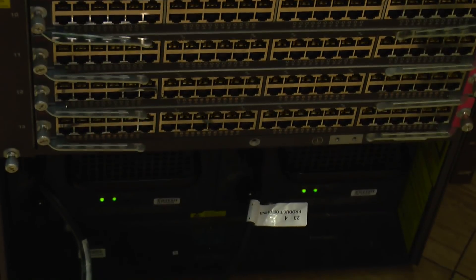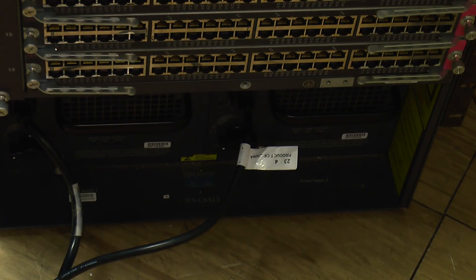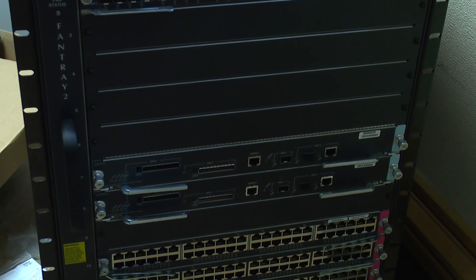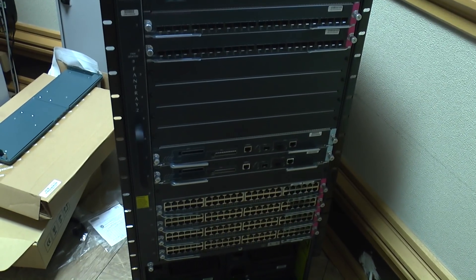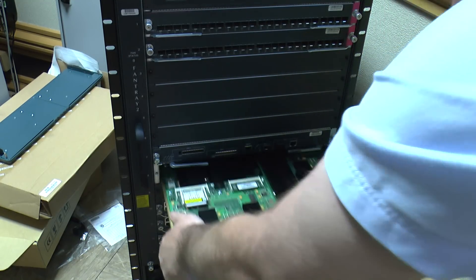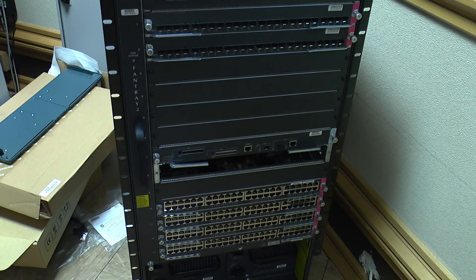Let's take a look inside. This is a modular chassis where the cards can be removed just by undoing the thumb turn screws on either side. You pull the levers and slide them out. This can even be done with the power still on, which is why it's got dual supervisor cards in slots 7 and 8. If one goes bang, the other one will keep on running the system, and you can swap the dead card out without shutting the whole thing off and bringing your whole network to a standstill.